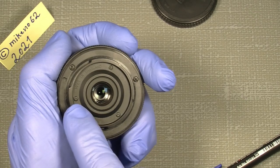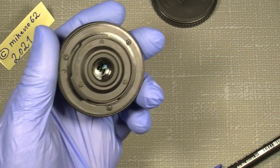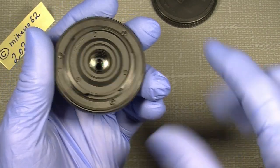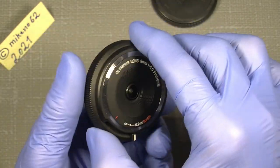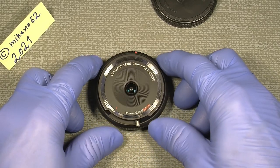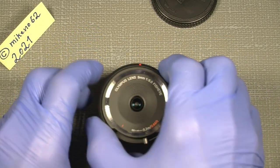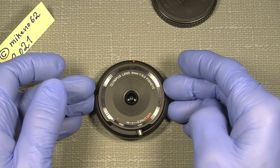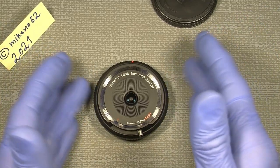Now we need to put in the big spring here to press the lens assembly down, but we also need to put the little steel ball into the little hole, and the little spring also comes in so it will just stick out like this. The big spring comes on, and then before you continue it's good to load a screwdriver. Use it here and use the other screwdriver if you have two — it's easier with two. The back cover covers the whole spring and lens assembly. There is a little boring where the spring can go into, so when we put it over, make sure one end sits there and goes in, then we can just put it on. The little guide pin will also go into the little hole. Then press it gently down and put the first screw in closest to here — press the spring down and it will make it easier. Then make the second screw and the last one for the last hole. Then the lens is back to normal — it can open, I move it, and then it goes to 20cm.